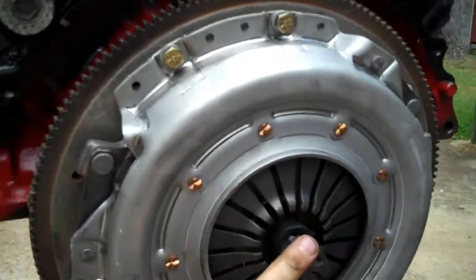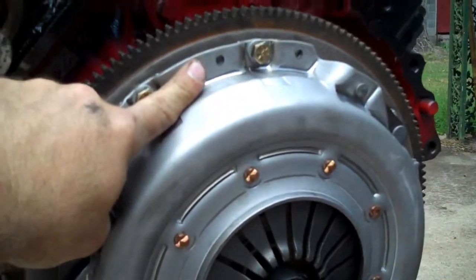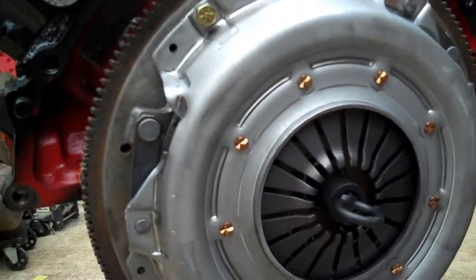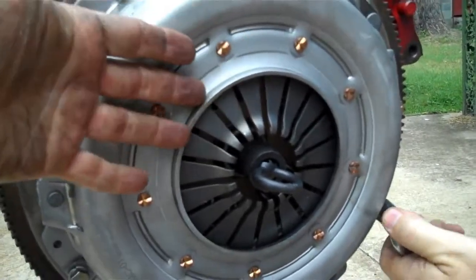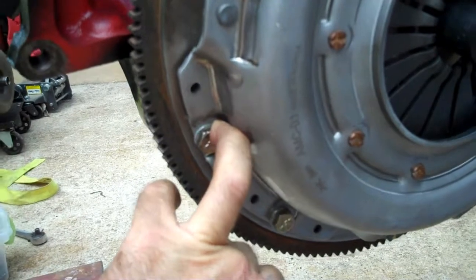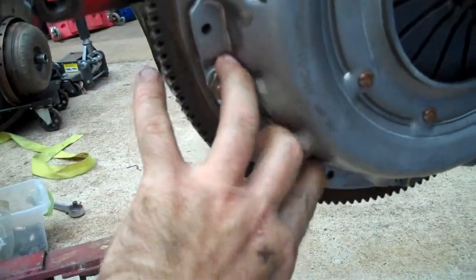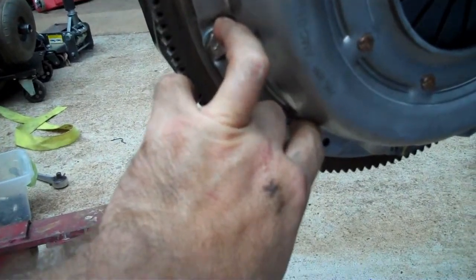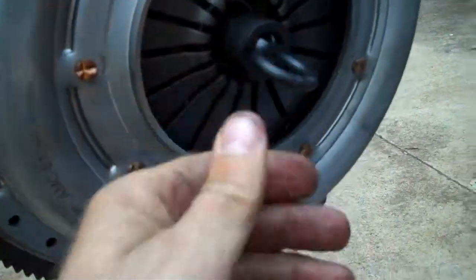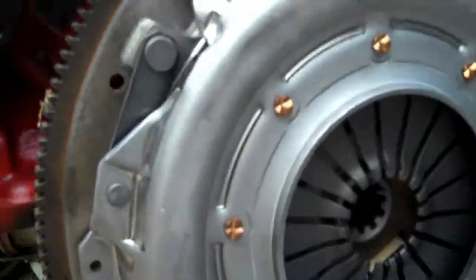We used the alignment tool to line the clutch up, then get your bolts started — just finger tight for now, not touching the pressure plate hard yet. At this point you want to crisscross tighten: a few turns here, come over and tighten a few turns there, work your way around jumping from one side to another. That way when you're collapsing the spring on your pressure plate you're getting even pressure all around. I'll put factory torque specs in the notation — for a 302 versus a Jeep they can be different, so look up the factory torque specs for whatever car you're working on.